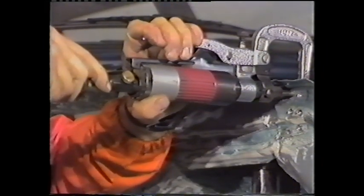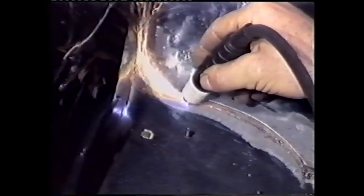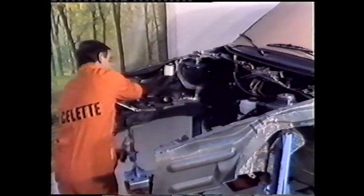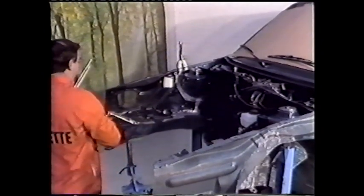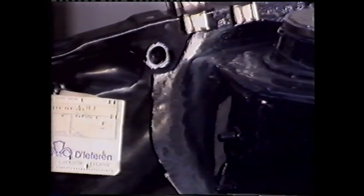With damage repaired, we begin replacing structural parts. The parts that are to be replaced are quickly removed. The new structural metal must match the old as a check of correct placement. When replacing structural parts, the technician simply bolts the part onto the appropriate fixture. This correct static positioning allows the technician to have both hands free for welding.